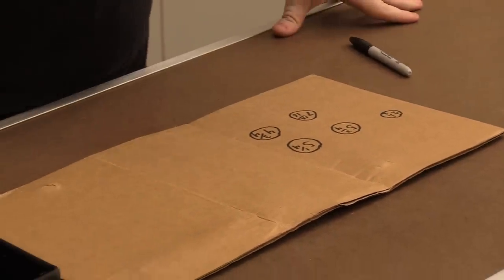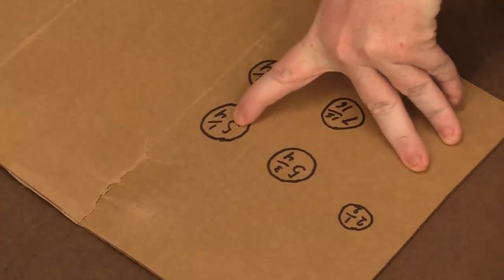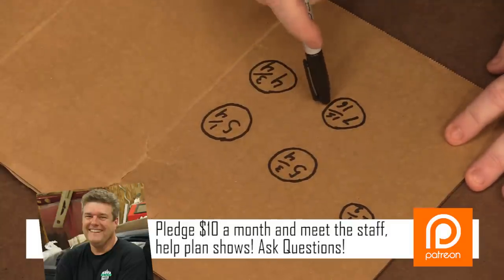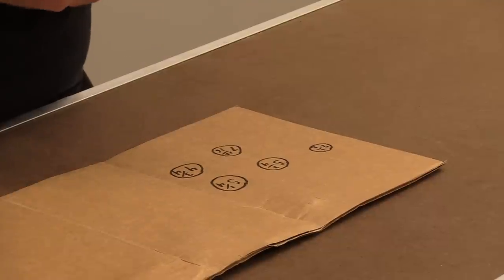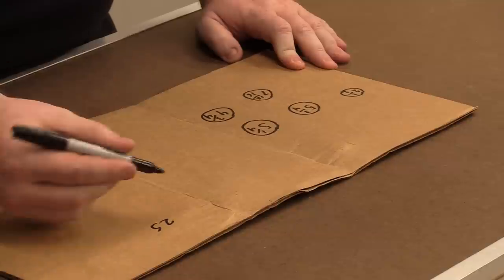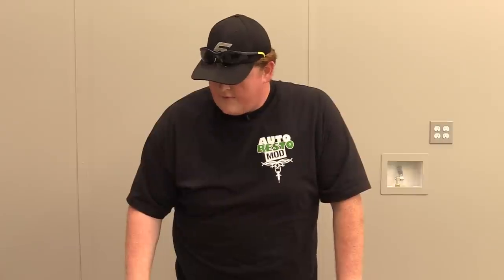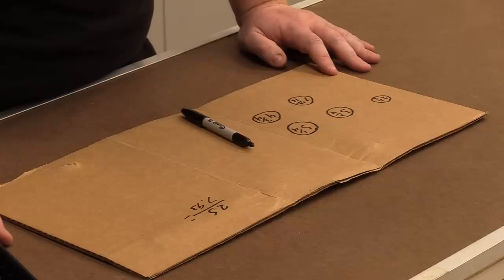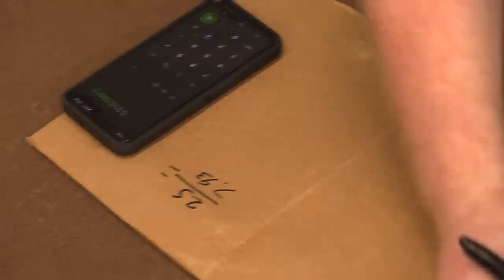All right, we're at our bench with the numbers. These represent the pulleys: crank pulley, alternator, water pump, AC compressor, power steering pump. The first thing — get a calculator because math. We have a 2.5-inch alternator pulley and a 7 and 15/16-inch crank pulley. So 1/2 = 0.5, and 15/16 is about 0.93, giving us a crank of 7.93. Your drive ratio is driven divided by drive: 2.5 divided by 7.93. That gives us a drive ratio of 0.31.